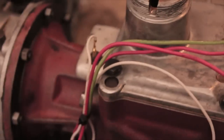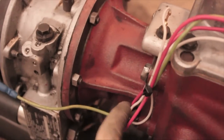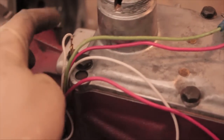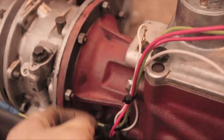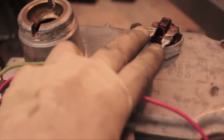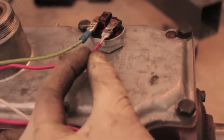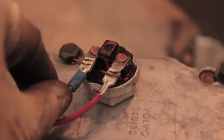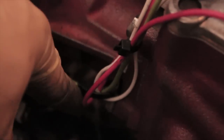What I've done here with the wiring is basically put a zip tie through that little bracket there. The green wire is the positive to the solenoid, the red one is the power from the relay, and this white one is our reverse lights. If you pull on these, it will tug on that bottom zip tie — it won't actually pull on the connectors themselves, because if one comes unplugged you'd have to wiggle your hand in from underneath the car to reconnect it. I also placed a little bit of wire through the connectors to keep these in place. All of our tugging is going to be done on that zip tie, and then these two wires will go back inside the car and be wired up.